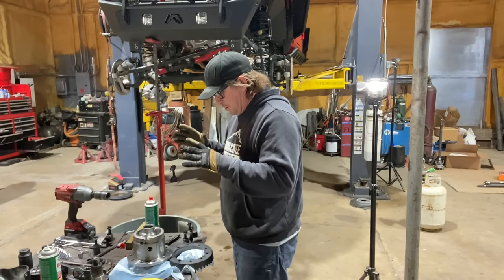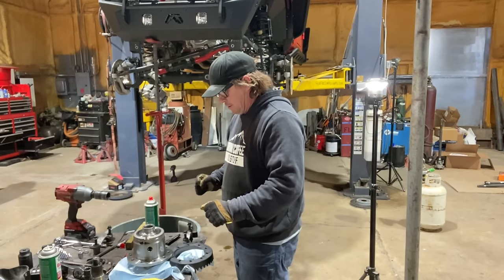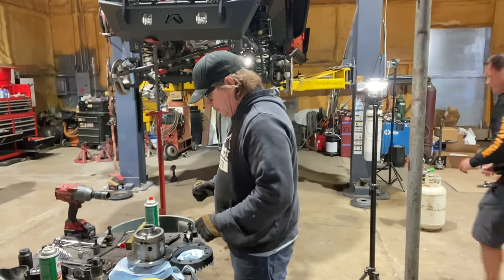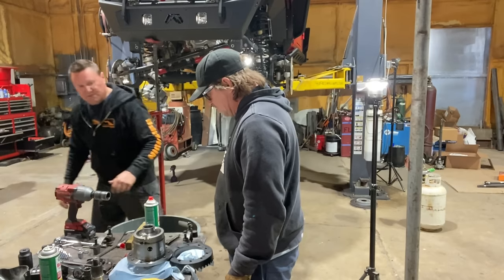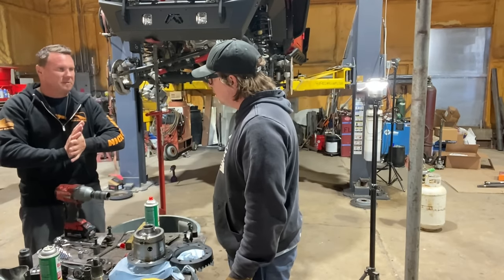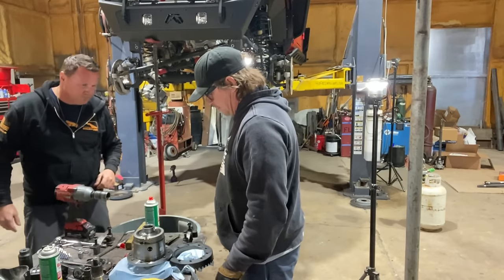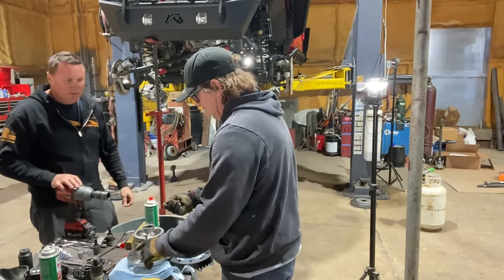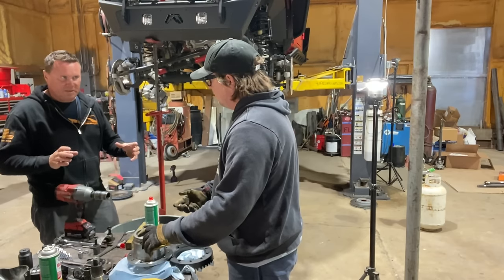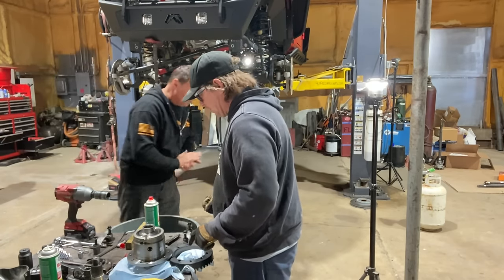Now, should the ring gear just drop right on? No, it does. It actually doesn't matter. It will center itself. That's probably the most important part, but really the force comes from the bolts clamping the two surfaces together. It's not a rotational force, it's a clamping force. Okay, so line it up, put a bolt through and get it kind of started, maybe one or two of them? Yeah, and once you get it centered, then run all the other ones in there, star pattern it, and then we'll torque it.